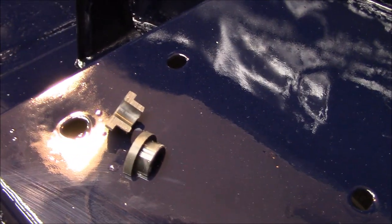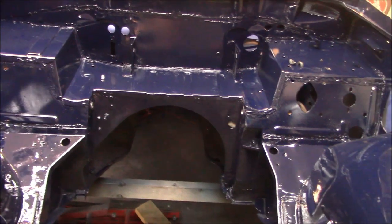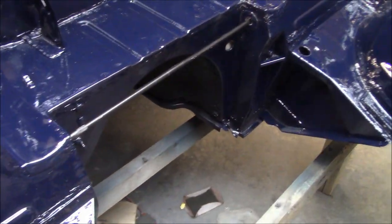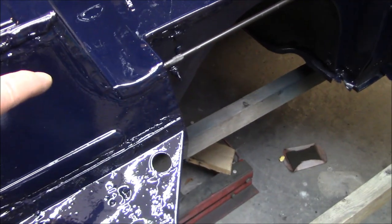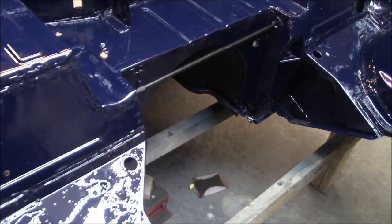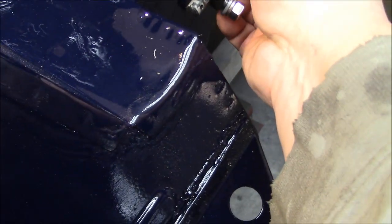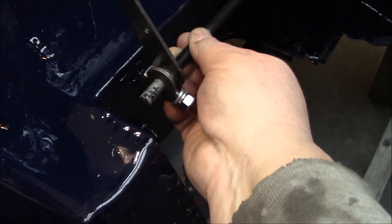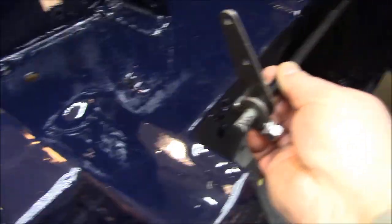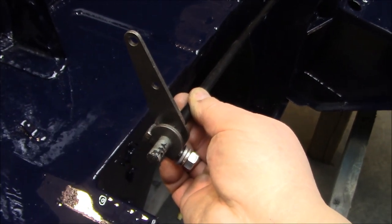We have the other bushing sitting ready to go. We're going to feed the throttle shaft up and in and across to that bearing. The throttle shaft is now through the driver's side and resting on the bushing on the passenger side. We're going to add in our bell crank — the bell crank and its fixtures go onto the shaft before we push it through to the inside of the passenger compartment. The flat washer goes against the body of the bell crank, and then the spring washer goes directly against the nylatron bushing.